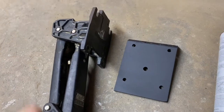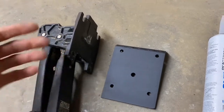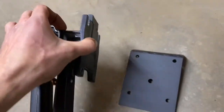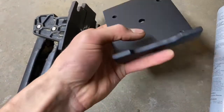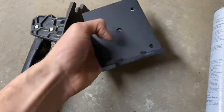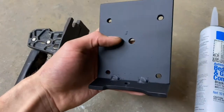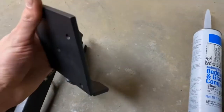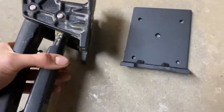These came up for about 500 bucks and I couldn't really pass it up — that's both boards, all four brackets with two motors, your harness and your module and everything. I really couldn't turn it down. I figured there was a way I could modify them. It involved cutting the top off so that it fit in the GM inner rocker. GM has one bolt up here and then one bolt down here on the pinch weld where the inner and outer rockers meet — that's how they mount their side steps. Ford uses four bolts on the inner rocker. So I had a set of adapter plates built for me — bottom holes threaded to thread into the pinch weld, and another hole that goes into the inner rocker. I have four of these, two per side, and basically these go up against the inner rocker panel. All four of these holes are threaded for five-sixteenths hardware so that the bracket can mount onto here.